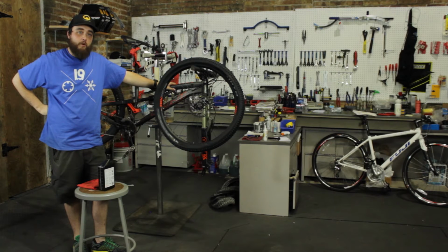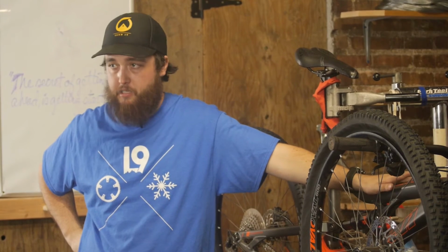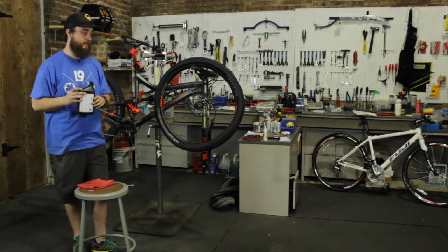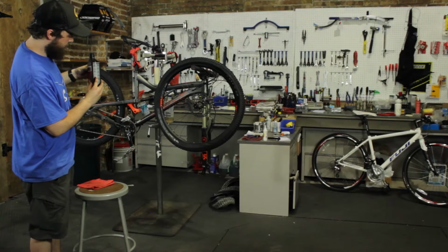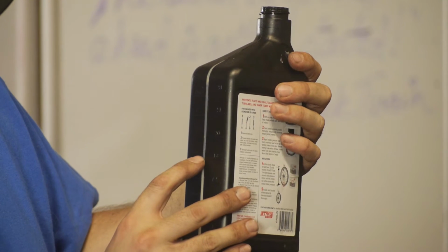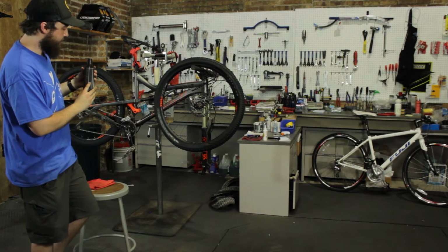For the front tire, what we're going to do is install the tubeless sealant without the injector. We will not use the Presta valve core removal tool. We're only going to use the bottle and the tire like this. What we will do is read what the bottle measures out to. This is coming in right at 16 ounces. We're looking to fill this with 6 ounces of sealant, so we're going to go out to a 10.